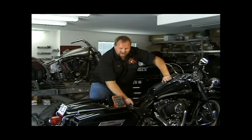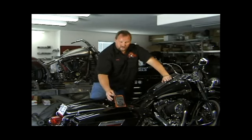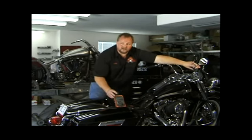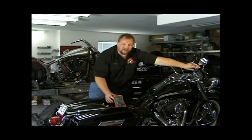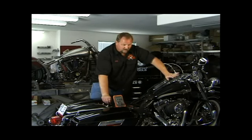When we started the bike, the voltage stayed above 9.6. As we increased RPMs, the voltage increased. You want to see a voltage increase with the increase of RPMs — up to around 14.5 volts. If you're not showing an increase of voltage with the increase of RPM, then there is a problem with the regulator alternator charging system.